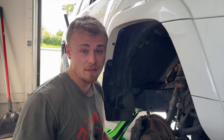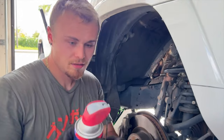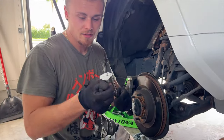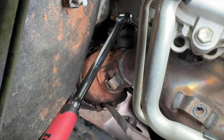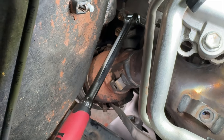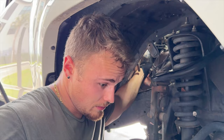After about two cycles with the induction heater, cooling it down with water each time using a spray bottle, on the third heat cycle you cool it down and the WD-40 will penetrate into the grooves and loosen it up. The next thing you need is a flex-head three-eighths ratchet — this tool is vital. Coming from above with the three-eighths extended, we got it right around the O2 sensor from the top, and then very lightly — I think it's a 72-tooth ratchet — turn it and it will free the sensor. Going through the wheel well this way is the best approach because you can then spin it out.